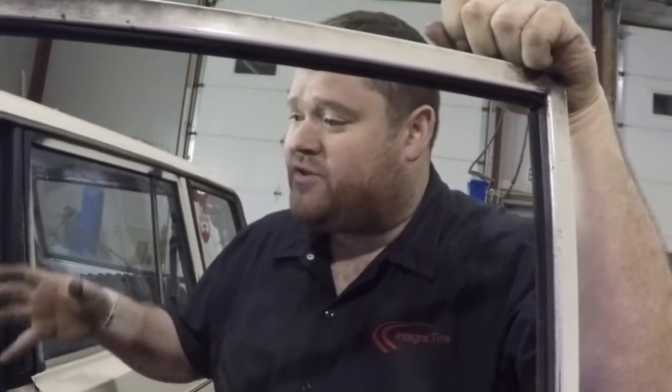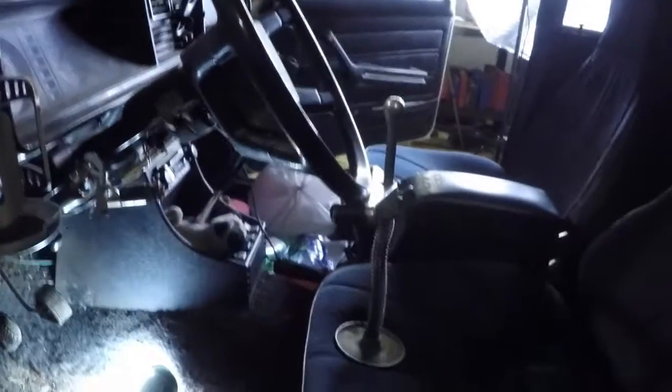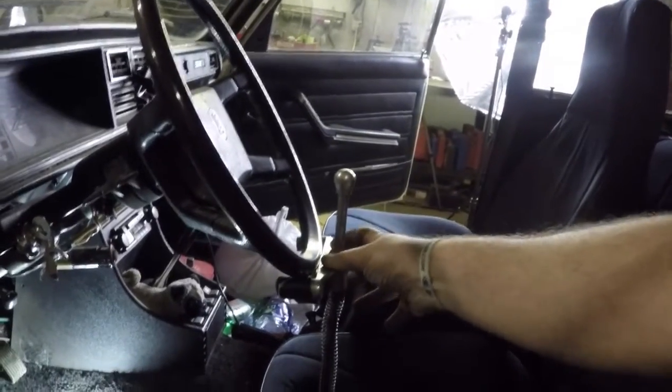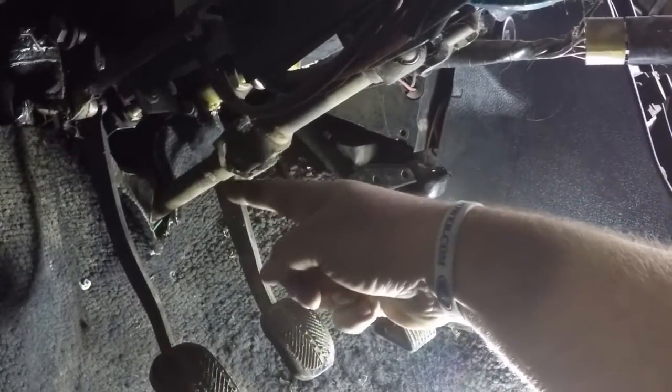First step when doing a steering box repair on one of these cars is you have to isolate the steering wheel. Now you can either use your seatbelt and wrap it around, rope, a club, anything really. Here at the shop, I actually have a steering wheel holder from our alignment machine, so we will use that. Once we have that locked, we have to go down underneath to this junction, and there's a bolt on the backside that we have to remove. Once we loosen it off, we'll hit some penetrating fluid. Then everything else is done from underneath the hood or under the car.